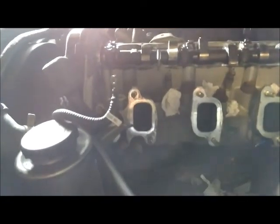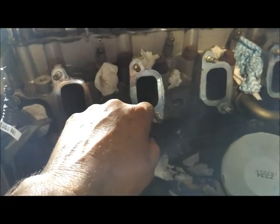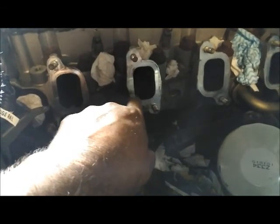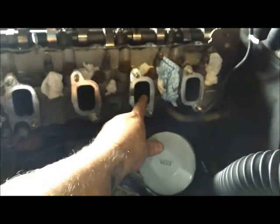I've been looking into the intake ports using an endoscope with a light attachment. Cylinder number two looks very wet inside — there's build up on part of the valve that looks like carbon but when I scratch it, it feels more like metal, on the top of the valve face where the concave comes down on the right hand side. That's a major concern. Cylinder number three looks really good, which is the one that gets the most EGR feed due to having the biggest hole on the manifold — which is interesting in itself.